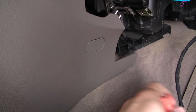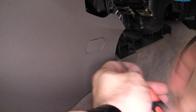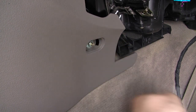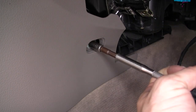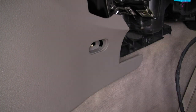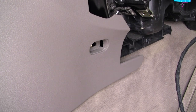There's a little cover here where the glove box was. Just grab your pick and stick it in there — you can actually use a radio removal key to do this. I tend to pick it from the back so if you mar it up you can't see it. There's another 8mm — actually it's a nut. Once you release that, it just moves freely.